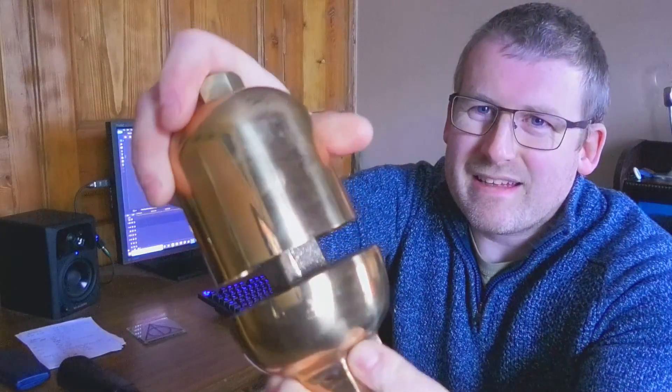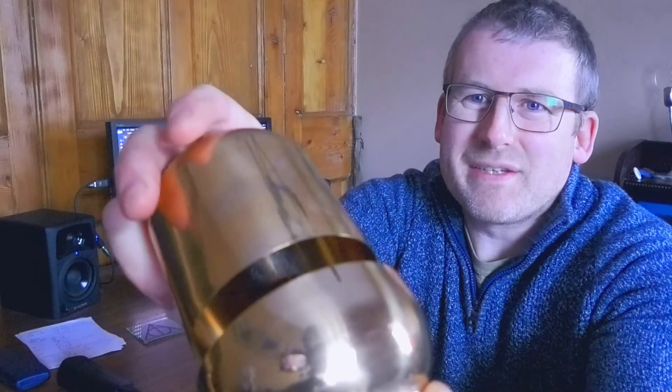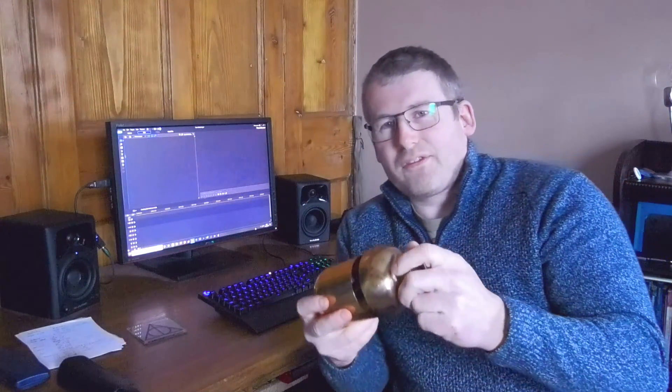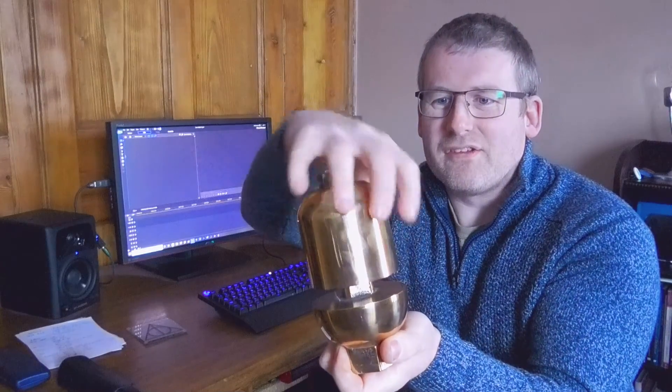So I'm going to ask the dog to vacate the house, put my e-muffs on, fire it up, and we'll give it a go. Now, this whistle is a little different to the other two, because this one - if you can see around there - it has a constant lip all the way around the edge. You've got this knife edge here and the lip plate in there, with the orifice going all the way around the outside. So this one doesn't have separated chambers - it's just one big open bell chamber.